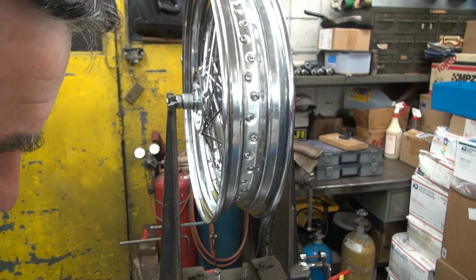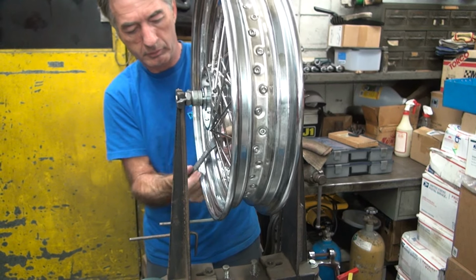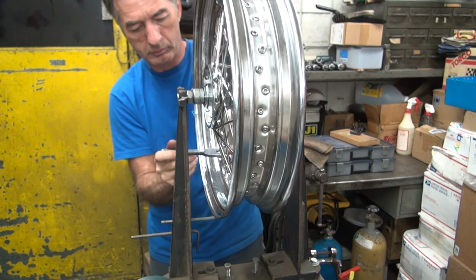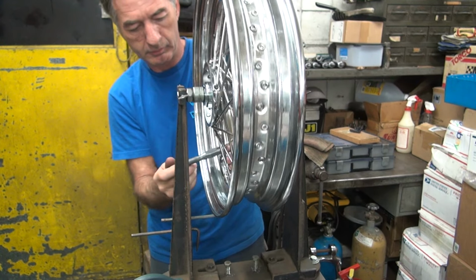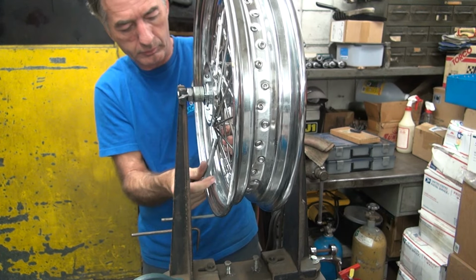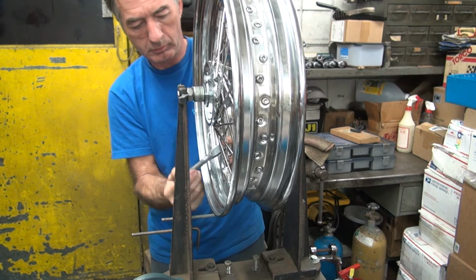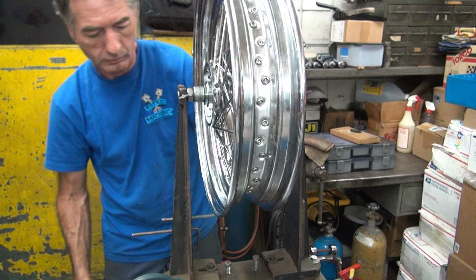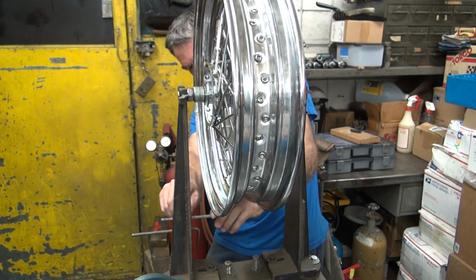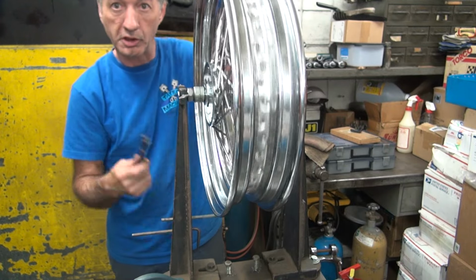Now I'm going to tighten this side of the rim up a little bit, and I'm going to go 1 flat tight on the tight ones and then tighten up whatever loose ones we have left, trying to equalize the torques. All these spokes are already pretty tight. They're all tight. Okay. Here's pretty even.